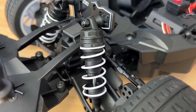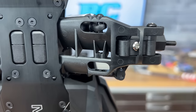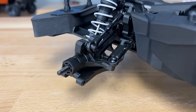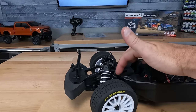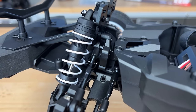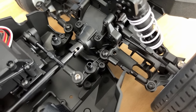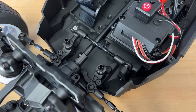The arms are absolutely awesome — they're an aerodynamic arm, you can see how it kind of has a wing design to it. Very sturdy. Then there's a highly adjustable caster block with all these different mounting points for the turnbuckle, and even a number of lower mounting points for the suspension pin. Interestingly, they don't have the tie rod mounted to the shock tower — they have an additional mounting plate that's actually part of the gear casing for the upper turnbuckle. Then composite steering knuckles and adjustable tie rods to the steering. It's just a twin bell crank setup, and I noticed there isn't a servo saver on here, which you don't see quite often with ready-to-runs. The servo looks like it's got plenty of throw.